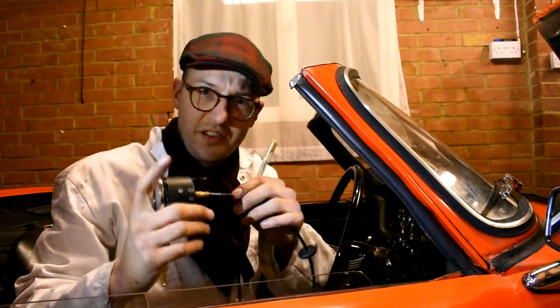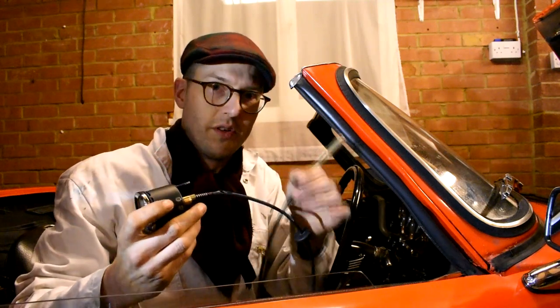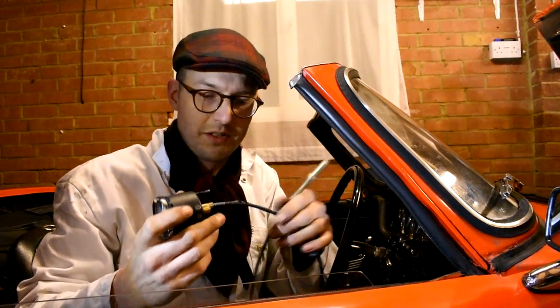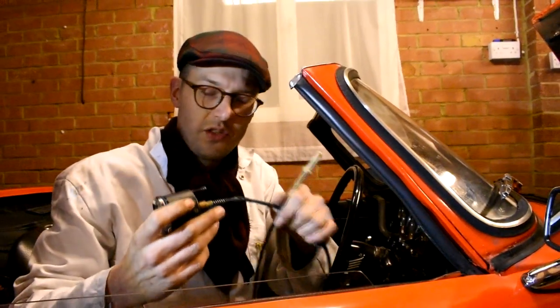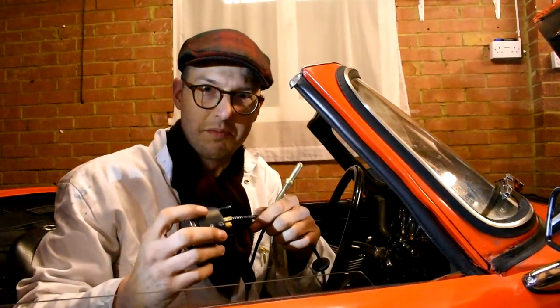I think it's a good idea for two good reasons. One, I have known these dual gauges to rub through on other wires and cause earthing problems and sparks — they can just be a nightmare. So that's one reason I've covered them in insulation tape. The other reason is that when you open up the bonnet on a car with a dual gauge, it just makes it look a little bit less noticeable that it's got a modification underneath the bonnet. So visually it looks better.